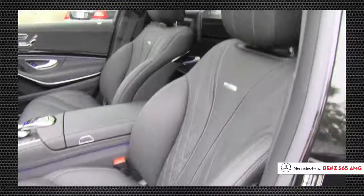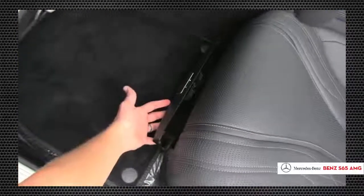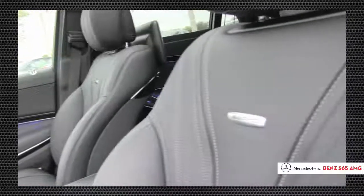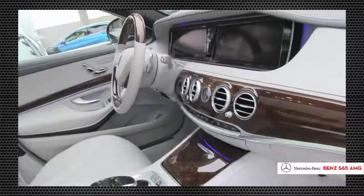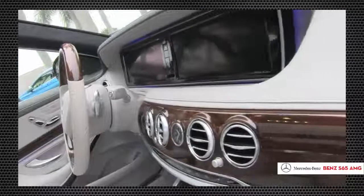With the seat ventilation, rather than pushing air out initially as you would typically see, it is a reverse fan that works to cool the seat faster for a few minutes, whether it be on a hot day or after the seat heaters have been used. Then it pushes the air back out like normal. This allows the seats to get cooler faster when desired. All of the bolstering adjustments can be controlled from the infotainment system, which I'll show in just a bit.